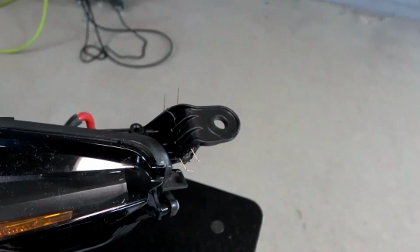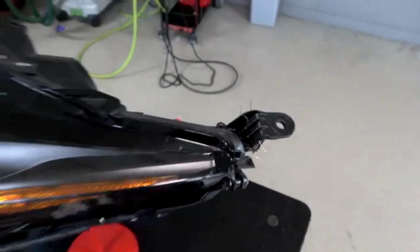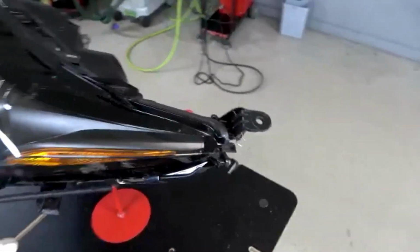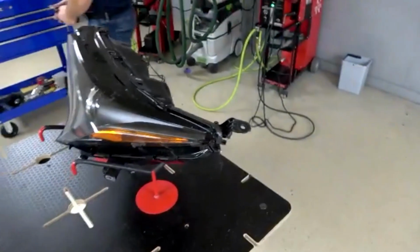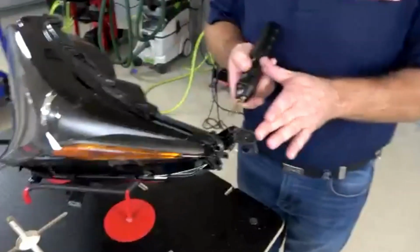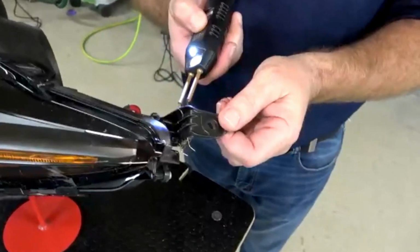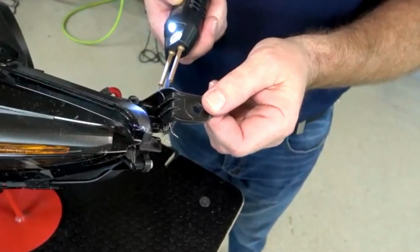Yeah. And that's one of the strategies we normally employ when we're working on a visible complex tab, because doing a one-side weld avoids the need to go over that top side with the welder again, which would really be hard to restore those features again after that.